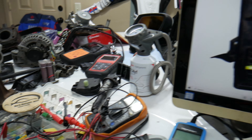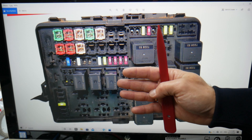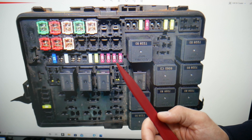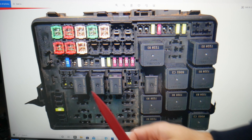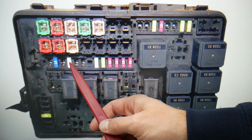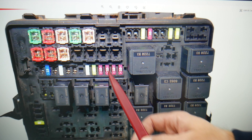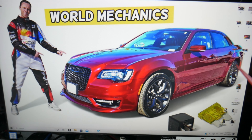So for the fuel injectors, multiple fuses will need to be checked. There is very limited information, but all these are engine management fuses, so we need to check them if you have problems with injectors. In that row of fuses right here — even if you have missing fuses, count the spot — you start with fuse 28, 29, 30, 31. Fuse 31 is a very important fuse. Then you go to fuse 34, 35, right here, then fuse 37. You also need to check relay 63, known as the ASD relay.